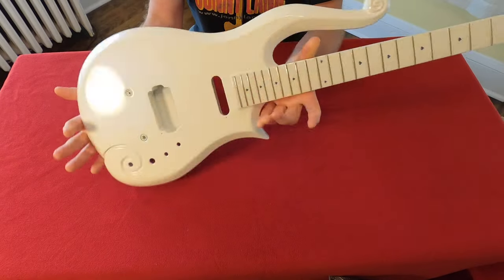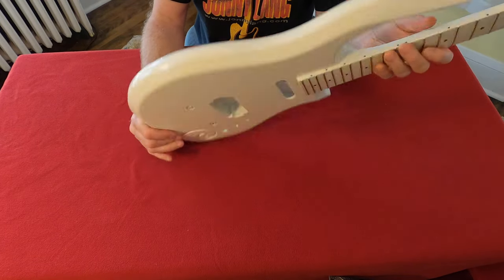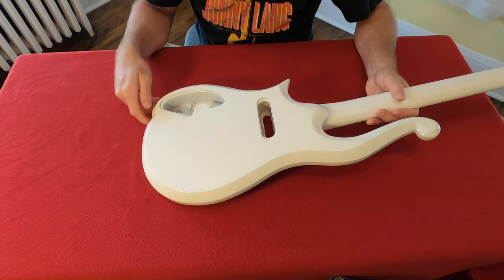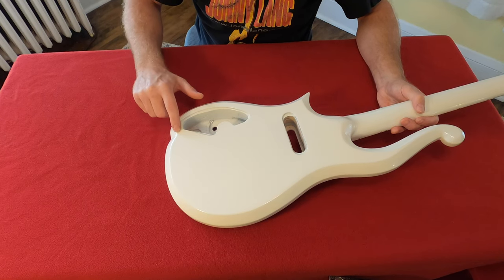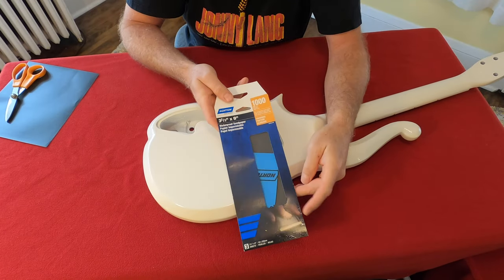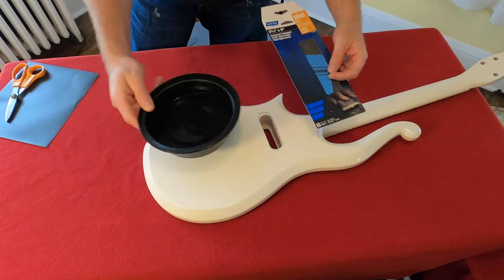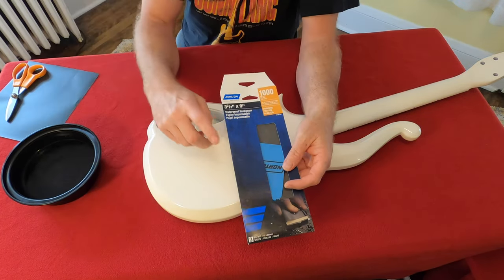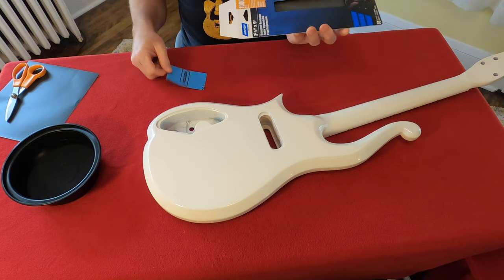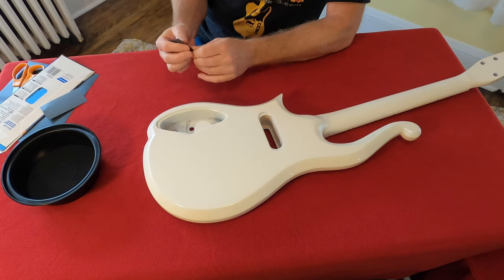And so now where we're at is I will go through, and there are going to be little tiny flaws in the clear coat. There's one dot there and a couple little dots there that I see that I will fix. There's a little bit of a thickness right here, but that's okay because all of that will sand out. I'm starting off with 1000 grit sandpaper, and I will wet sand this. So I've got my little thing of water here. I'll set that off to the side, and I will just use 1000 grit sandpaper. And I will wet sand it. I just cut them into little pieces here. And I'm going to have to grab a rag as well.